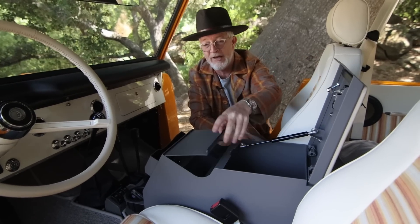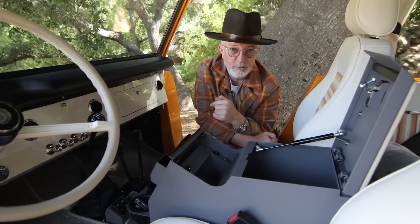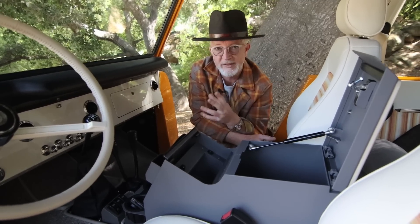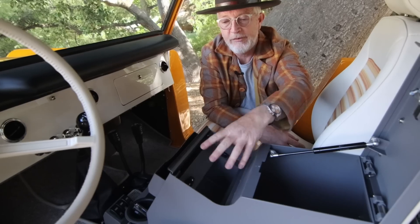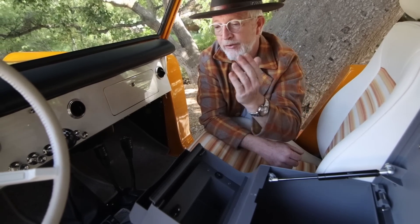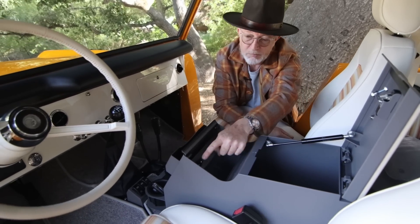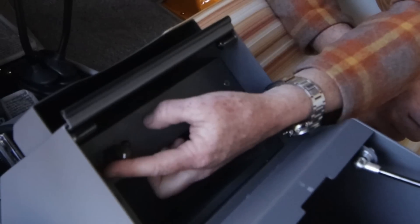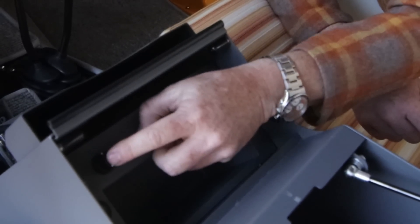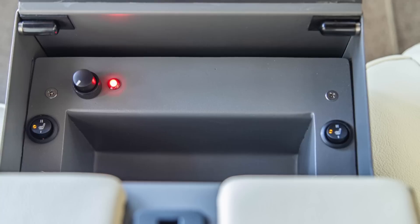The front audio sub compartment has gas shocks and stainless steel construction — super stout, really good quality. On a roadster we generally do a smart device Bluetooth-dependent audio system, so we added a cubby storage box here since we don't have the traditional full-size head unit. From your phone or tablet it goes through a Bluetooth receiver and digital sound processor. This black knob controls volume, the lower rotator is for the bass circuit, and you push down on it to pair the Bluetooth link. This truck also has seat heaters, which in a roadster will definitely come in handy.